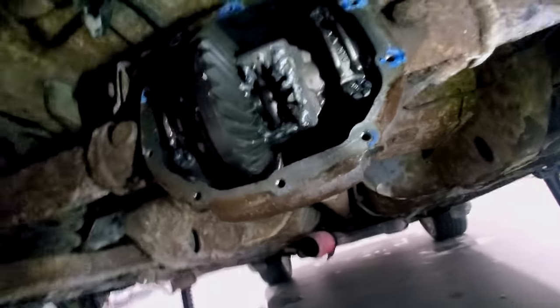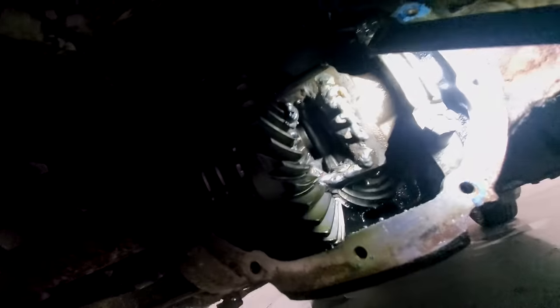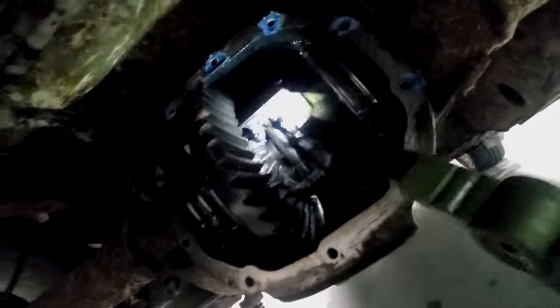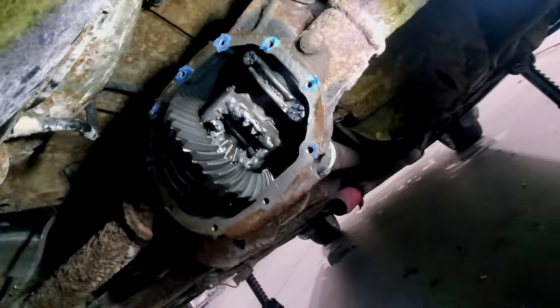These are the final results. There's a saying: when in doubt, make it stout. You really just want to fill in everything along where the gears touched the housing — welded that up. The back corner was kind of difficult and my neck got pretty fatigued, but all the corners are welded up on both sides. I think it's going to hold up pretty good. Worst case scenario it blows up and we put an 8.8 in it.